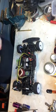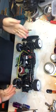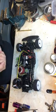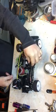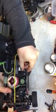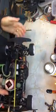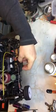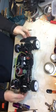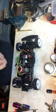As I say, I'm going to try and start this car on a little bit of throttle, on idle. If it's cold and it doesn't want to start on idle, then the way to start this car normally would be to turn the car off, open the servo manually. I'll just show you how to do that there. Open the servo manually slightly so that the throttle is open, start the car, and then immediately turn it on, and when it turns on it'll reset back to idle. And that's the way to do it. But for this car, we're just going to leave it like that.